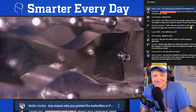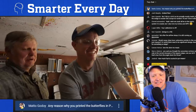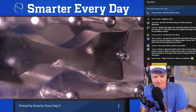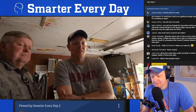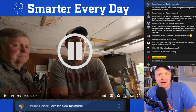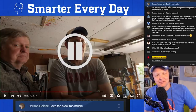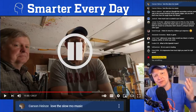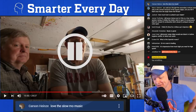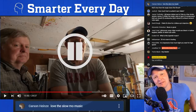Derek is going to love that. Because of turbulence? Yes. That's changing a laminar flow coming in here to turbulent. Ooh! Converging, diverging nozzle. So a carburetor is just a rocket nozzle. It's a rocket nozzle. That's what it is. Got some heat in one of the subreddits. They're like, it's not a rocket nozzle. It is because, you know, in the diverging part, after supersonic, the velocity of the gases accelerates in a rocket nozzle. And that gave me a little existential crisis.